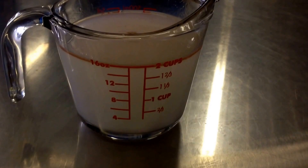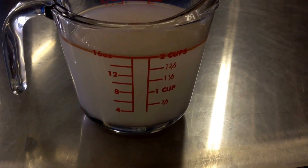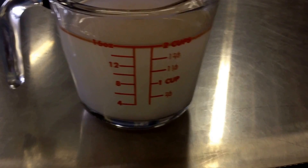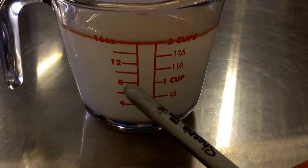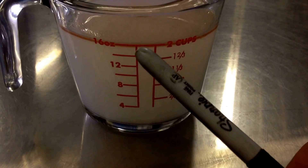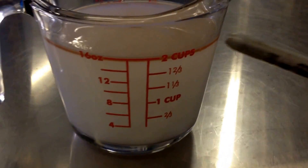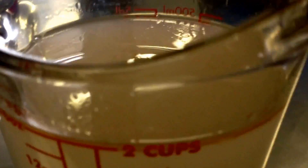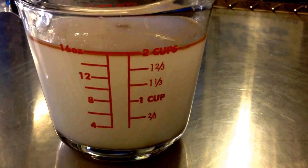What we have here is 16 ounces of tap water and E93 mixed. I filled 8 ounces of E93 and then filled the rest with water. You can see there's some separation on the top — I'm guessing that's the oil additive we put in all the ethanol we get here. We put one quart of oil per 55-gallon drum for lubrication in all the ethanol we run.